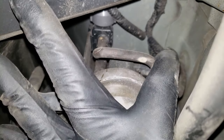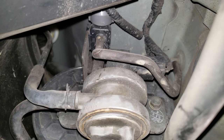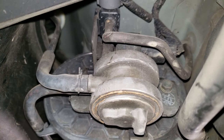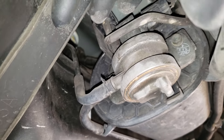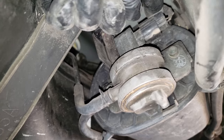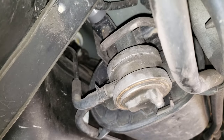The part with the red writing attaches to the body, collecting outside air. Problems with the vent system are also reasons you may have trouble filling your gas tank, because if the vapors have nowhere to go the fill nozzle will stop or allow fuel to spray out the filler neck. When testing this with a smoke machine, you'll want to command the solenoid to close, or if not, you can plug up that vent — or you can remove it from its spot by removing the two bolts for easier access. For now, we're just inspecting the hoses for any cracks or damage.